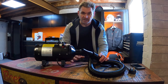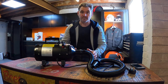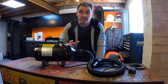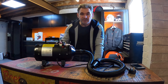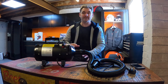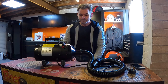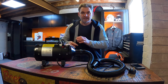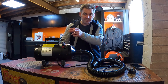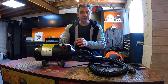The thing that kills motorbikes, the thing that creates rust, is moisture on your bike. Obviously, moisture, oxygen, all the rest of it, I get all that. But it's not the drips, although they will cause rust. The drips you can just wipe off with a microfiber cloth or a chamois leather or whatever. You can get rid of the drips, but the bike still holds moisture. As you'll see, when I start drying it, especially on the downpipes of the exhaust, where there's no drips on them, it looks dry, but you give it a blast with the hot air and you watch it change colour.